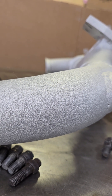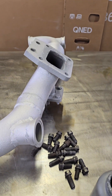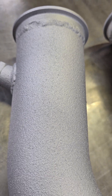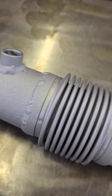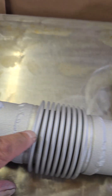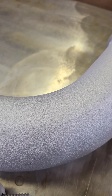The whole point is to keep the heat in. I expected a smoother finish and asked if they hadn't completed the process or needed another coat, and he said no, that's the way it is. I was wondering if maybe they didn't do it right, but we're going to see how it works when we start the car up. One thing I noticed — the bellows were not sprayed with the plasma wire, just the ceramic base coat. So this is the Jet Hot 2000 degree coating — it is not smooth like the 1200 degree polished coating.